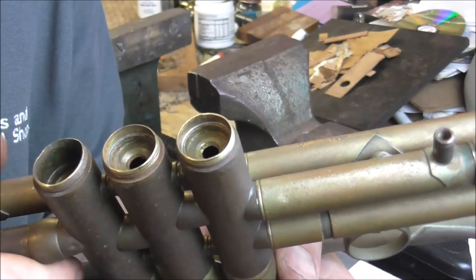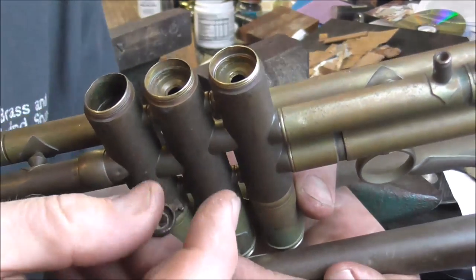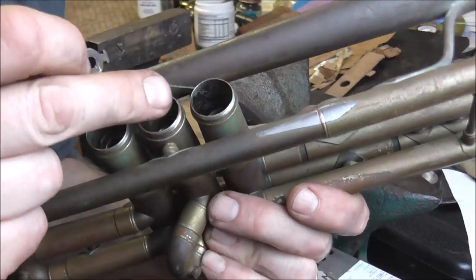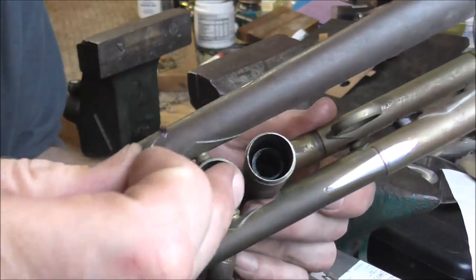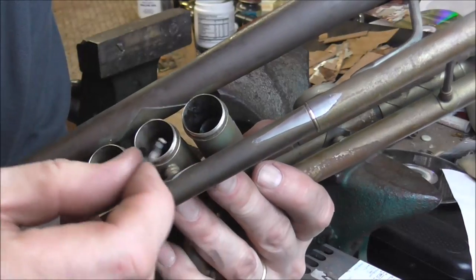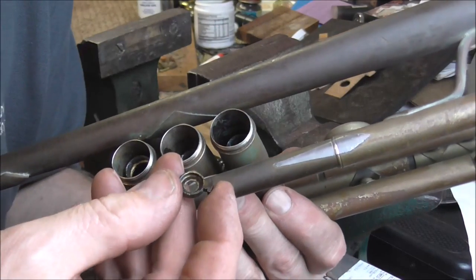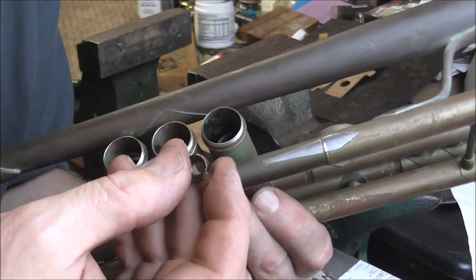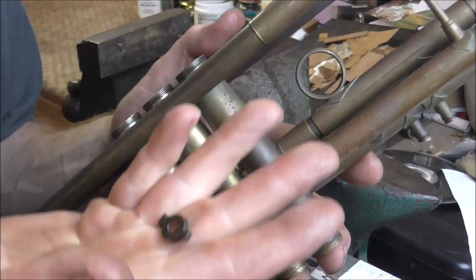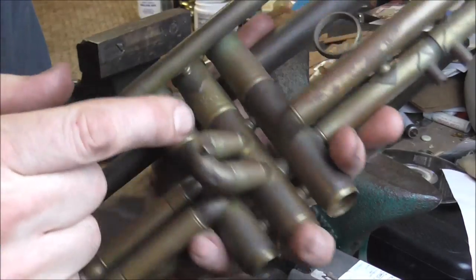I've pushed the valve back and forth probably about 20 times, and it's gone down a considerable amount. The valve guide was stuck inside of the valve and I couldn't get it out because the valve was pushed down too far. But once I got it up a little bit farther, I could move the valve guide around inside of there. It was a little tricky, but I had a small pliers and worked it loose. So now I can push this valve out the bottom — before I could not because the valve guide would get stuck once it went out a little bit.